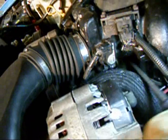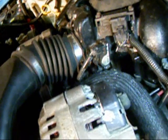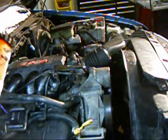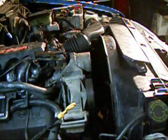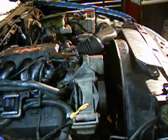When you get it out, there's a Torx bolt that holds the end of the pintle. Get a Torx socket, or even a standard screwdriver that fits tightly in there. Don't remove the bolt — just spin the pintle, and by spinning it you can clear the mating surface of the pintle and the EGR valve body. I had a check engine light coming on and off for a long time, took the valve out, didn't see any chunks, but after cleaning that pintle with this method, the check engine light didn't come on anymore.